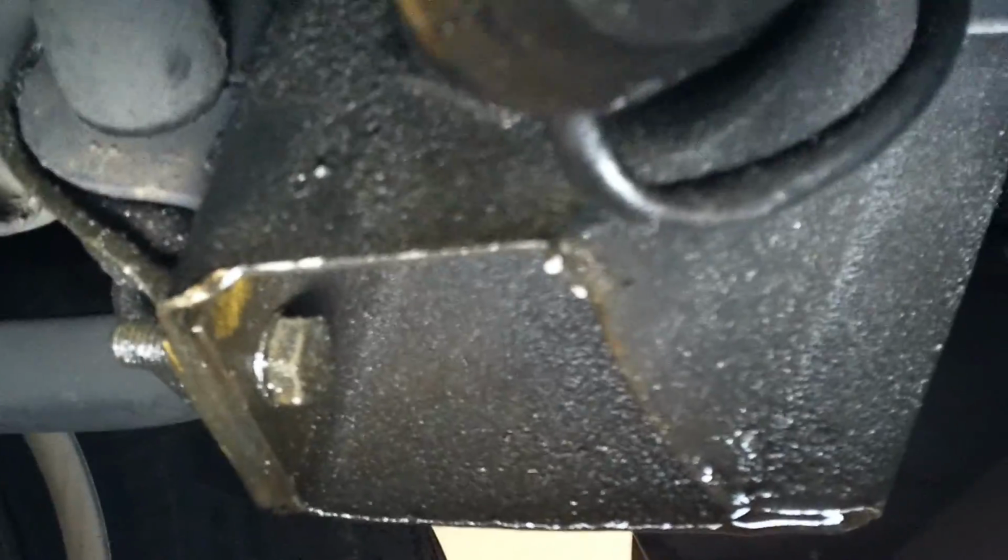I just want to go over a couple things. I know you're not here, you're in Memphis, so at least you can visualize what's going on with this. First thing I want to talk to you about is you can kind of see the wet spot in the front. This is a front lower valance on the car. That right there is actually a power steering leak that's developing. You can see a drip right there. There's two hoses on the top that are leaking, that are causing this. So that's one thing I want to show you.